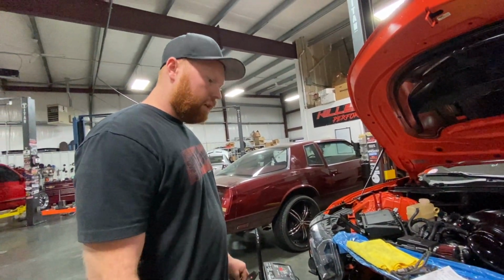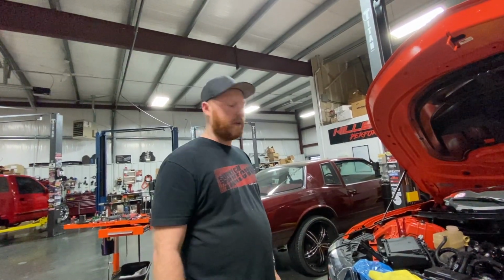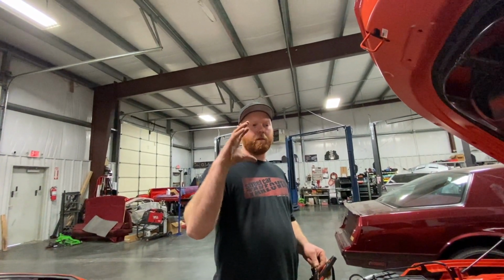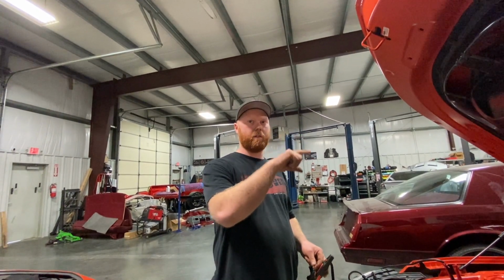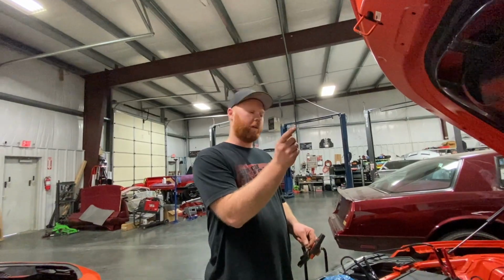And you did the oil cooler delete deal? Actually, no, because the LT4 pan is different. So basically I just left it on there and looped it back into itself, because the LT4 is different than the LT5 dry sump, because the cooler is actually part of the pan. It has that big seal around it. That's how the oil goes through. So you just leave it on. Yeah, like the teal truck, we did the Holley pan. So that's why we put it on there.